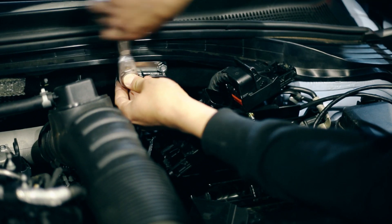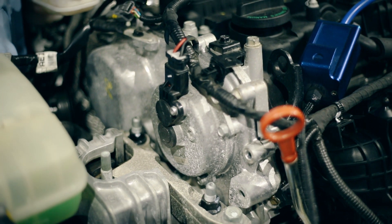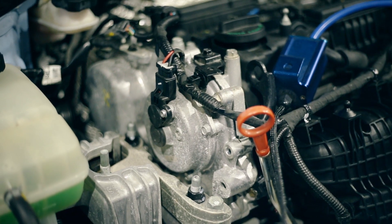The purpose of the MoTeC dual half bridge is to drive the electronic ECVVT inlet camshaft. On this car this is quite unique, as most other vehicles that have variable camshaft use an oil pressure actuated camshaft gear. In this car it actually uses a servo motor to control the position of the inlet camshaft at any point during the engine's operation.